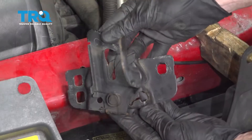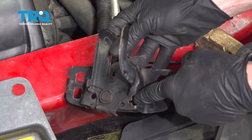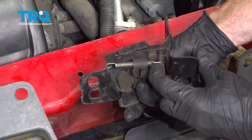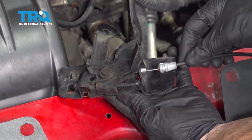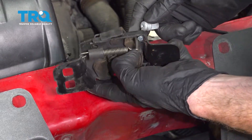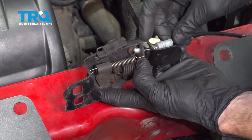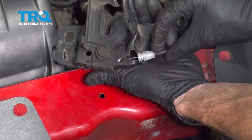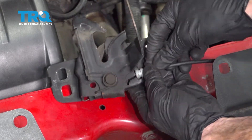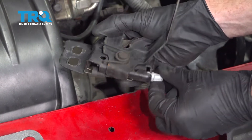There's our latch. Now it's time to install our hood latch. When we do this, we wanna put the cable through the forward aspect. We'll turn this over and then we're gonna put the rest of the cable through this area. You can see it's right inside the groove there. Now we'll turn this over and we're gonna slide the groove of the cable into the housing. Once it's lined up, go ahead and lock it in. Listen for a click, give it a tug to make sure it's secure and it cannot fall off.